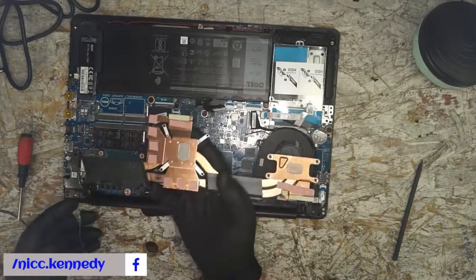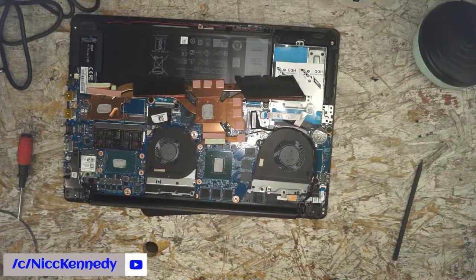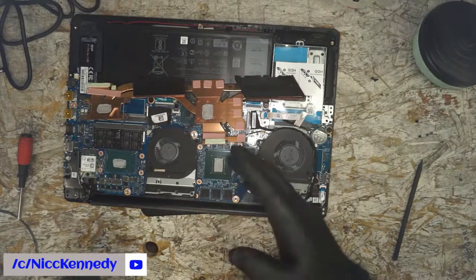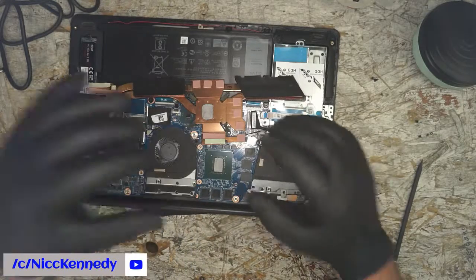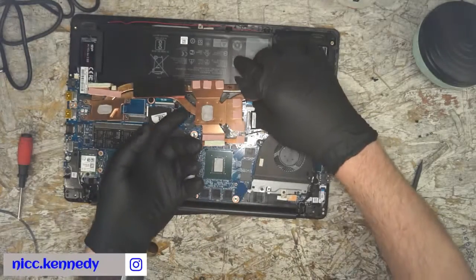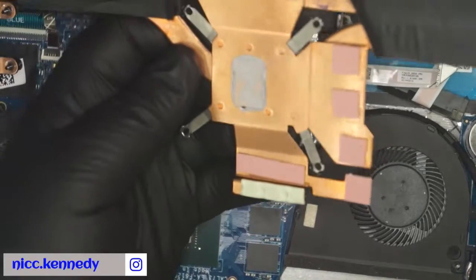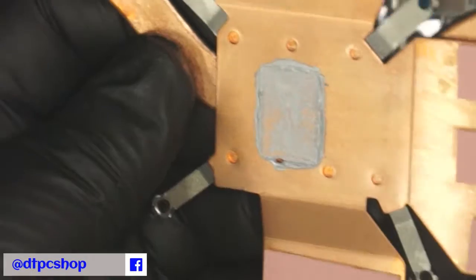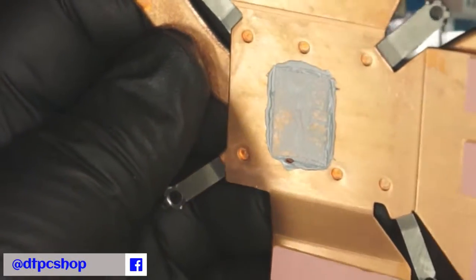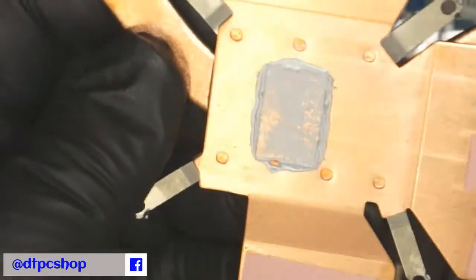Okay, so there's what we're looking at. Like I said, I'm not much of a fan of stock. Now granted, let's say it was new and wet thermal paste. When you lift it, you're going to create these little air gaps. But I truly believe, let's try and get in there on that. Okay, you can see, I don't think those gaps were created lifting this off of there. I think those gaps were created by it drying out a little.